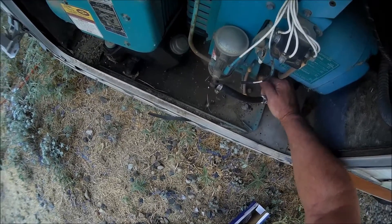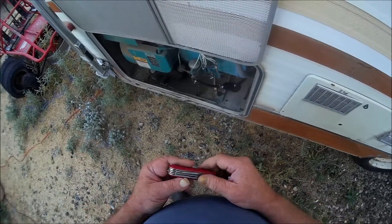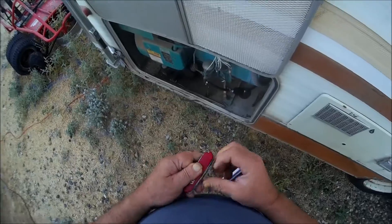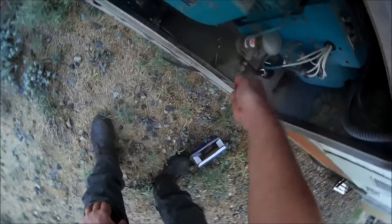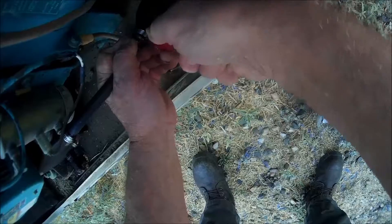Let's see if this bulb works. Got a leaky gas line right there. It's going to need to tighten up a little more. That's probably why it won't hold a prime — sucking air right there. It leaked a little bit here so let me snug it up too. Leaking a lot right there. I can't get it with this, I'll break out a real screwdriver.